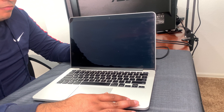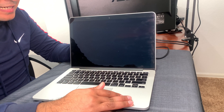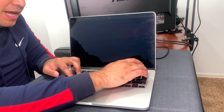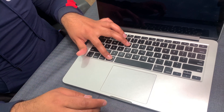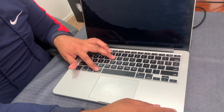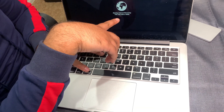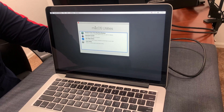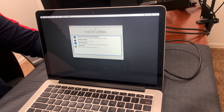After you have installed your new hard drive, when you open it up it is going to go through recovery mode. Since the laptop is connected to the internet it will do an internet recovery. Press the power button and immediately hold Command+R as the machine is booting. It goes through the internet recovery options - you'll see 'Starting Internet Recovery, this may take a while.' It is trying to recover the OS using the internet.